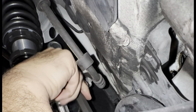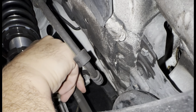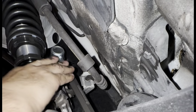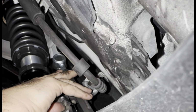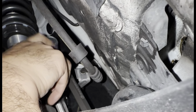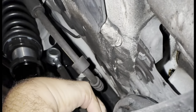So it's really tight that way, and it's loose, and then it's really tight that way. So there's a sweet spot of kind of just nothing, where there's no tension on it. That's our sweet spot, that's adjusted. So there's no preload on the sway bar. So yeah, I've had to do it vertical because it's the only way I get the phone in there to film, but that's it. So, you know, lightly wind down the captive nuts to hold it there.